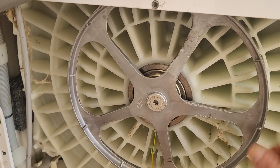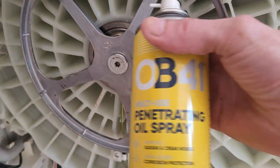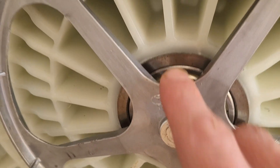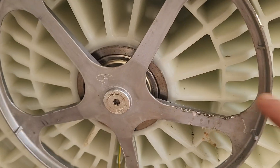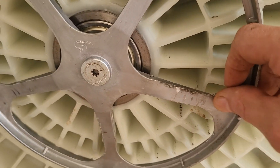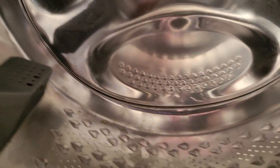What I did was spray a load of penetrant right into the top of the bearing there. I was hitting it for a long time with a hammer and couldn't get anything to move. So I left the penetrant to settle for half an hour.